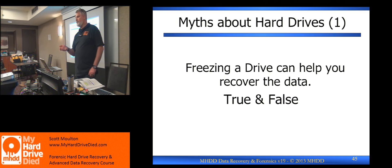That's why sometimes bringing a hard drive or laptop in from freezing cold outside and starting it up rather than waiting for it to return to room temperature can cause it to lock up or lose the drive. Metal contracts when it's cold, and if your heads are already flying close to the platter and they contract, you can scratch the platter and do more damage.